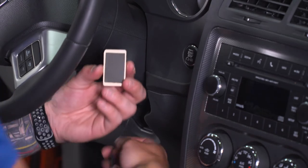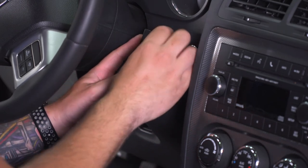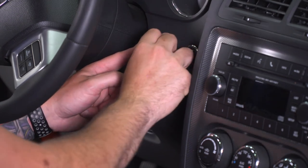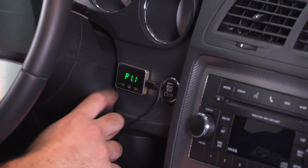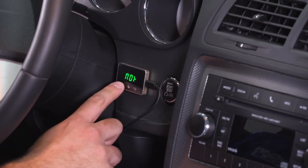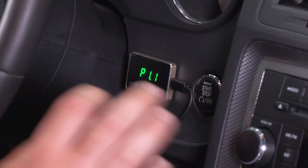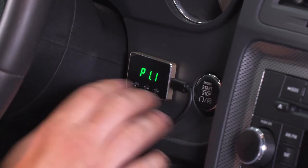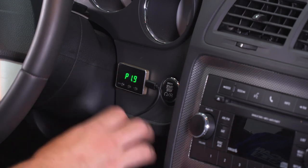Peel off the backing, bring the wire up, and connect it to make sure you have enough wire. Pull up a little more and stick it into place. Right when the device turns on, you'll see it's lit up in green and shows P1.1. P1 refers to the mode, and if you select the mode button, you can flip through P1, P2, P3, EC, and normal. P1 is comfortable mode — it gives you a small increase in throttle response with smooth acceleration, something that isn't super instantaneous but still feels a little more peppy. The dot 1 refers to the level of sensitivity; use the plus and minus buttons to flip through levels 1 through 9.